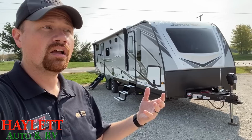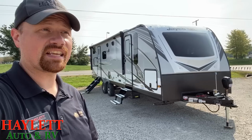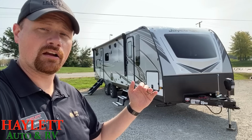So yes, it has an aluminum framed laminated series of sidewalls. There is some other aluminum in the construction of this. However, like the front wall is aluminum framed out. The roof though, this has the exact same roof material as a J Flight. It has that 5/8 plywood roofing. It has big, heavy vaulted roof trusses. Now, a White Hawk ceiling is different. It's vaulted inside and outside instead of being linear inside and vaulted outside like a J Flight.